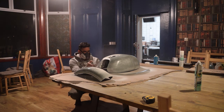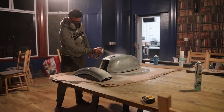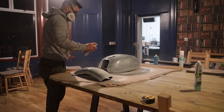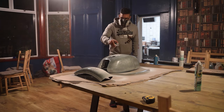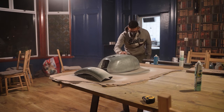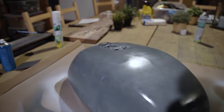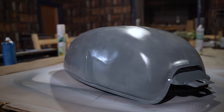We finally got to the stage of getting our color laid down. When it came to choosing the color there really wasn't much choice — it was what I had lying around. This was actually a color match I got from an old VW Crafter I did up a few years ago, so it's a Mercedes blue-gray that we're spraying down here. As a first coat I was quite light with it, just dusting it to start, then slowly building up the layers. At this stage I didn't know what to expect from the final finish — the paint didn't really lay down glossy at all, which concerned me a little, but I knew it was something we could work on once it dried.